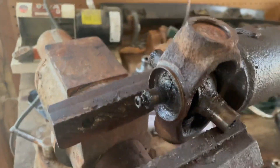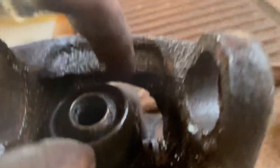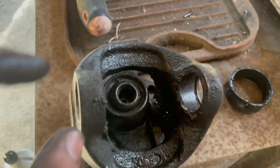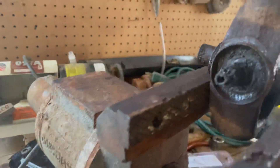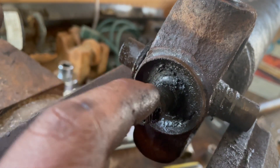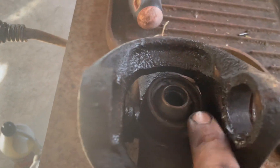The more I get into this thing the more confused I am. There's not only just two u-joints — there is some weird extra joint in there that doesn't even look like it's replaceable. It looks like you have to buy the whole assembly. There's a bearing in there and that's all metal — I don't think that even comes out. And that's also part of the entire drive shaft, so this doesn't come off. That bearing has got to be replaceable, but I don't know how you'd get that out.